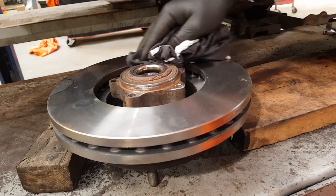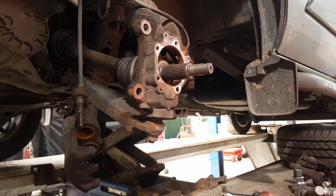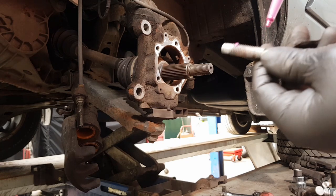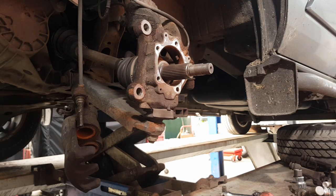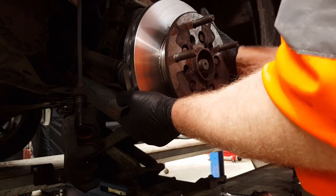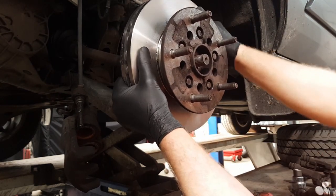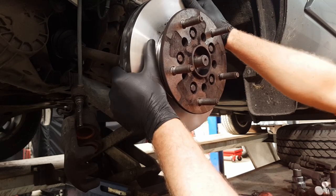Make sure the surface where the hub sits into the strut is nice and clean. These are the mount bolts with a tapered end - put a bit of Loctite just a little bit up the thread, not on the tapered end. Put the hub on, locate the driveshaft by turning it until it locks into the splines. Then line the hub up and look through the hole where the Torx bolts came from to align the wheel bearing hole with the hub hole before inserting bolts.